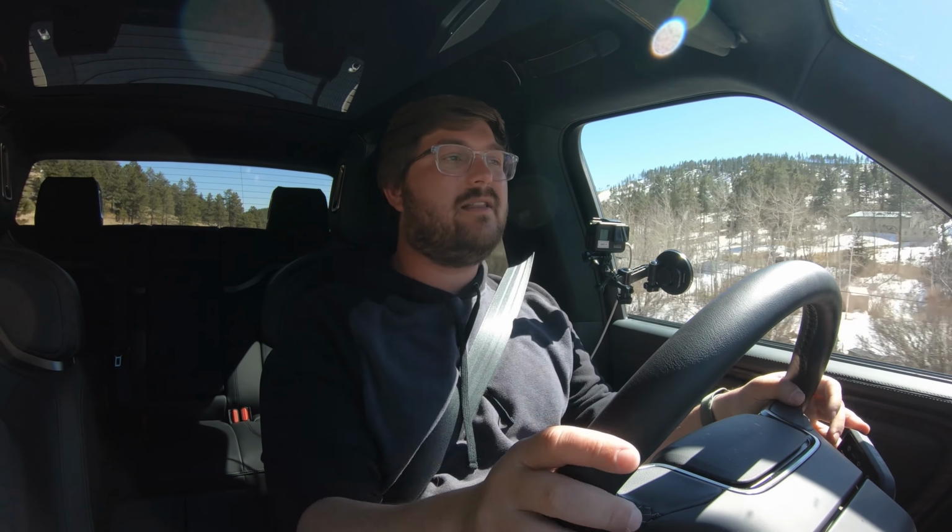And I'm honestly so impressed with these tires. They're Pirelli Scorpion all-season tires, but they're a Rivian OE tread compound selection, as well as an electric tire. So it's designed to handle the compromise between longitudinal acceleration and deceleration, so big torque loads forward and back, but also the low rolling resistance of needing to get range. And this vehicle has huge range. I tested it at just about 290 miles at 70 miles an hour.